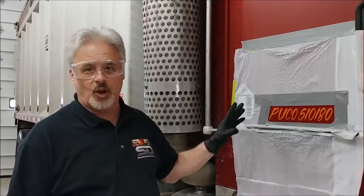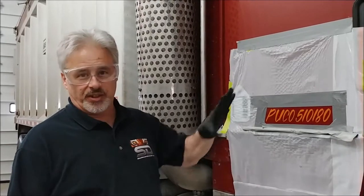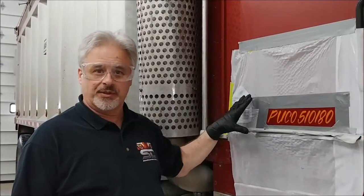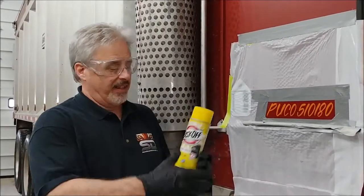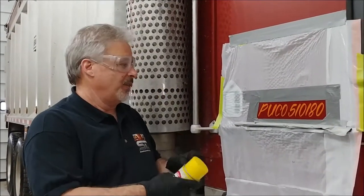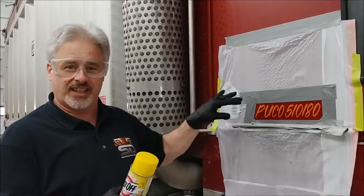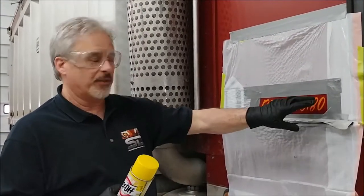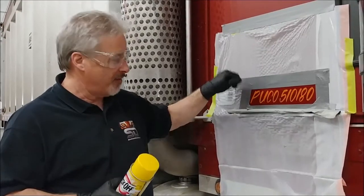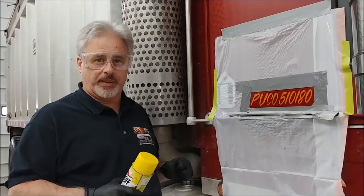Today we're going to remove old hand lettering — a 1980s technique. We're going to use an area masked off with plastic and duct tape, and our favorite kitchen cleaner: Easy Off oven cleaner. It's a very caustic lye that will start to eat at the lettering and, after a certain period of time, bubble these letters off. We'll scrape them off until it's clean, then quickly neutralize it with soap.